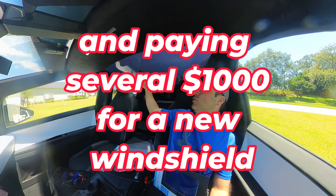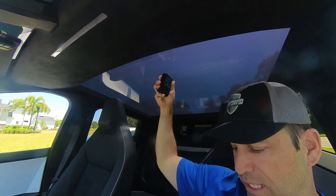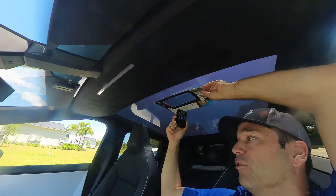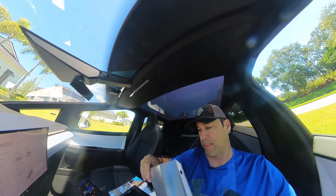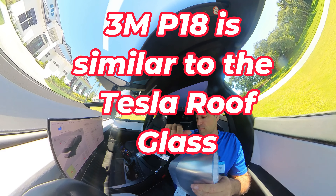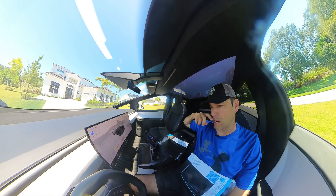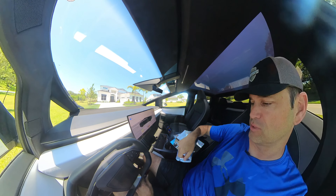Let's take a look at the roof. The roof's at 21, which is what you're going to get if you double up on your windshield. Let's see if we put Prestige 70 on the roof and what it drops down to. It takes it down to 3 — so almost no solar energy is getting in on that roof. That's pretty much like this product here, 3M's P18. We can go look at the roof, but it's a silver reflective film. So if you were going to tint the roof and you put Prestige 70 on it — not a silver film — there's no difference in the darkness. I'm going to go to the trunk and show you what the back glass looks like and why you don't need to do that.